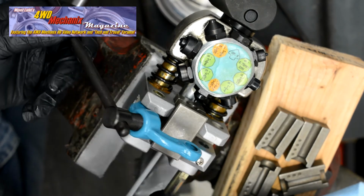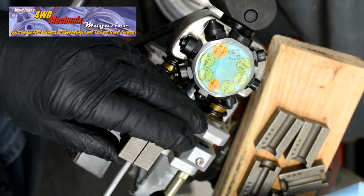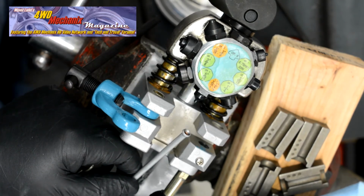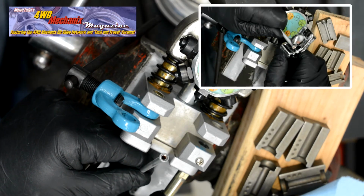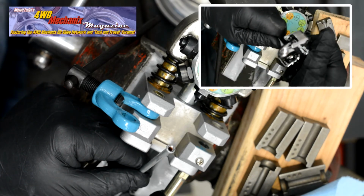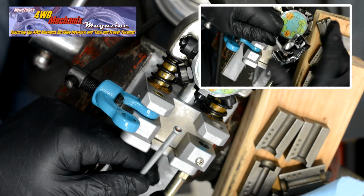The die set and tube removed, the die halves can be separated to reveal the tube. This tube flare looks good. The improved flare seat and flare indicate either the tube end is more square or the tube end was slightly recessed from the die set end.